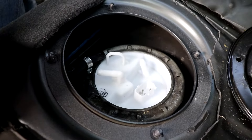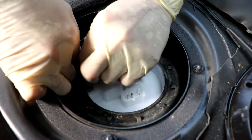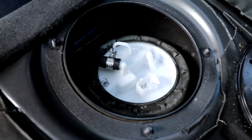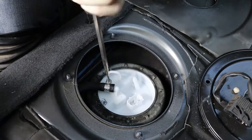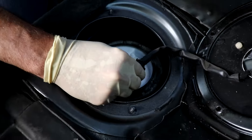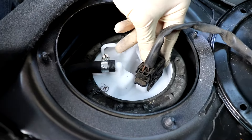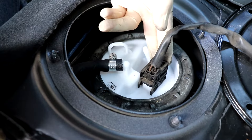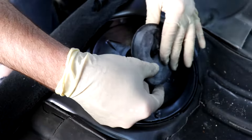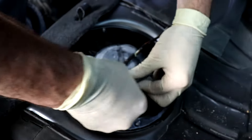Pull off the little dust cap for your hose and get your hose right back on — I never even took the hose clamp off, so we're good. Get it down in position and tighten it up. After you get it tight, put your plug back in — it's gonna press in and then lock into position by pushing it towards the driver's side. The arrow faces forward, and then you can reseat the rubber sealing ring around the lid.